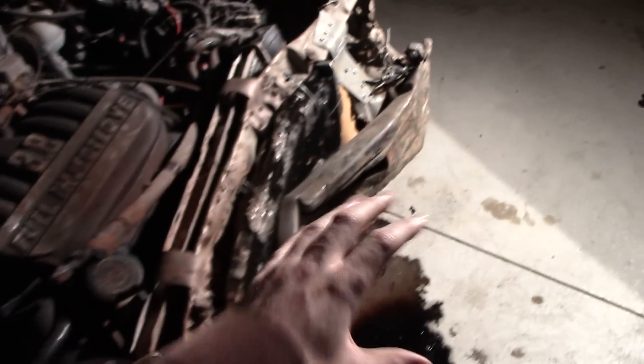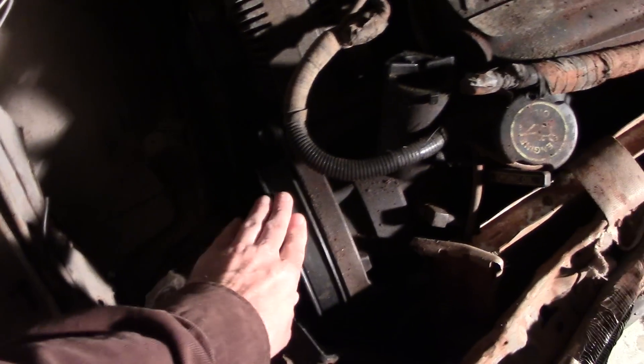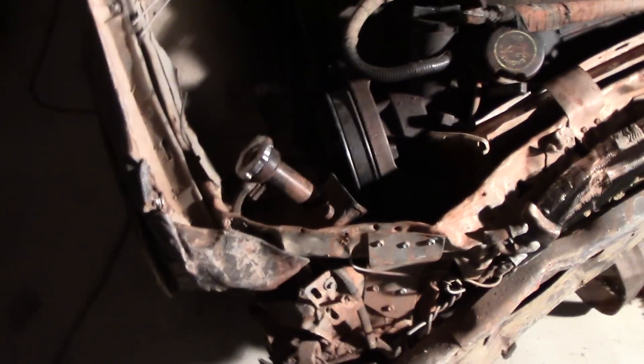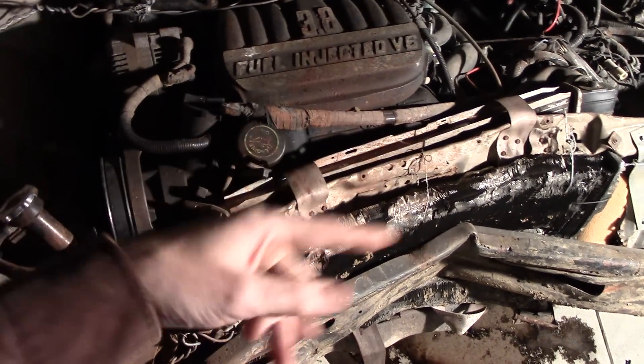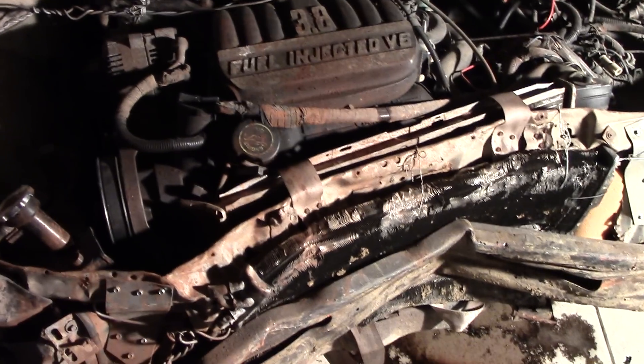That is a good amount — it's pushed all the way in, we're hitting with the engine at this point. So we got to get the bumper off, we got to get the destroyed radiator out of it because the radiator is split in half — there's the tank, there's the extra radiator split in half right here. Luckily there's a belt still good on this engine, hopefully still good when we look at it. Let's get this AC condenser off, yank the whole core support back out straight, and check all of our wiring connections and spark plugs behind the radiator that's been crushed.